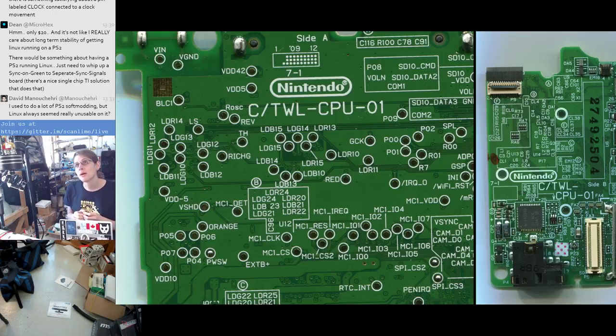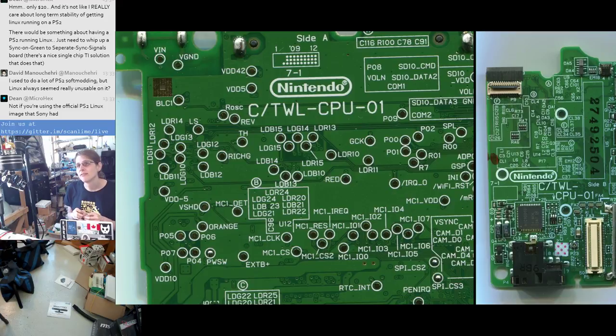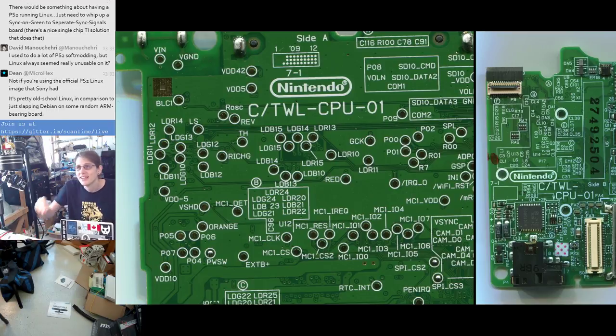And it seemed even more promising because there's more RAM, there's a built-in SD card slot, but all of that extra hardware was locked away by default. You had to put the processor into a different operating mode to use it, and normally that operating mode was only accessible if your cartridge had an additional cryptographic signature. So they were introducing this chain of trust, and you could opt out of the chain of trust, but only if you were using the older hardware mode, which wasn't that interesting. So the idea was how to break into that chain of trust in order to run arbitrary code on the system.